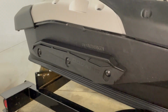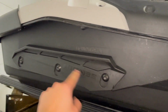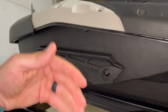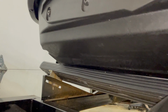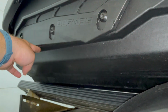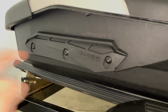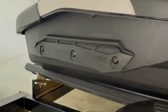Alrighty guys, we got the sponsons flipped, and so we just pulled out the three bolts. This SEA-DOO used to be down here, so all we did was flip it this way. We didn't flip it from left side to right side or anything like that. So you can see right here that we pretty much have zero sponson on the bottom side anymore. We just got this tiny little edge. Otherwise, the sponson flip, in quotation marks, is pretty much a sponson delete, but you still need bolts in the side here so that you don't sink your machine. So this is how you finish it off.